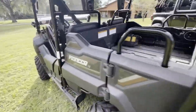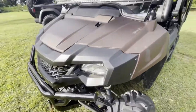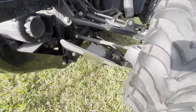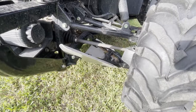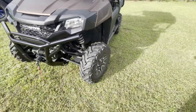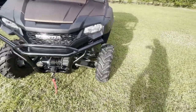Next thing is the A-arm guards. They don't really add any style or fun, but they sure can save you a lot of money. That's the aluminum piece you see there — it's kind of like a skid guard for your A-arms and for that axle with the CV boot. Without these, a lot of people poke holes in those CV boots if you're riding on trails, clear cuts, that type of thing. So that's definitely another must-have item.